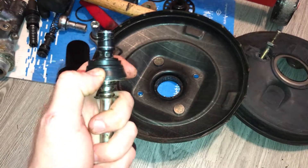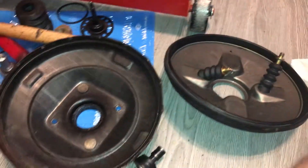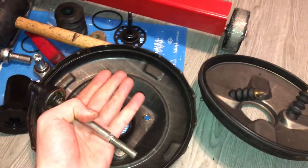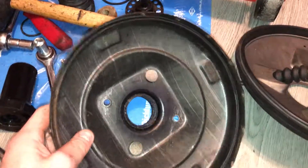So this is kind of like a two-in-one valve. When you push the pedal, not only does it close off the connection between both halves of the diaphragm to create an inequality, but it also allows atmospheric air to come up from around the pushrod and take the place of that void as the engine vacuum pulls this forward. That seems like the gist of how it works.